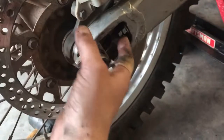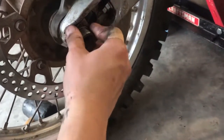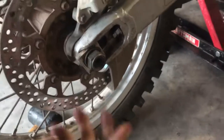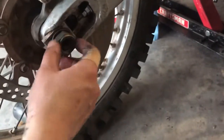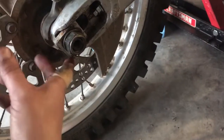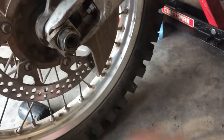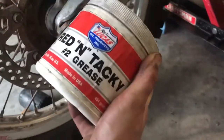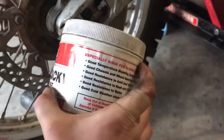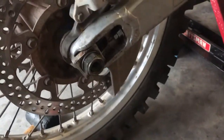So this is where you're laying with the wheel on. If you're not taking your wheel off you're not replacing these — these are really long, you might not have to take your wheel off to replace it, but it's just easier. This is a 1 and 1/16th — you're going to have to loosen this either way so you can move your wheel back and forth. It's simply the other side. This is the grease that I used to grease the shaft, and it's worked well for me.